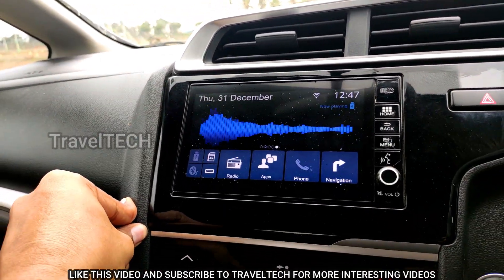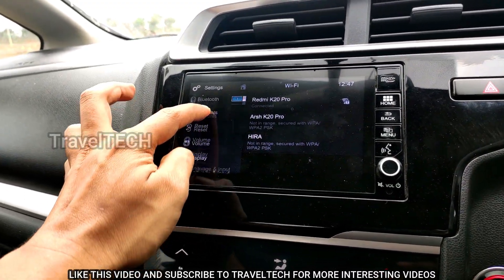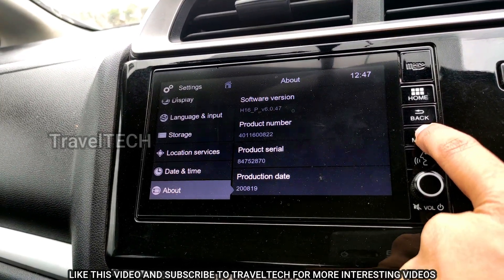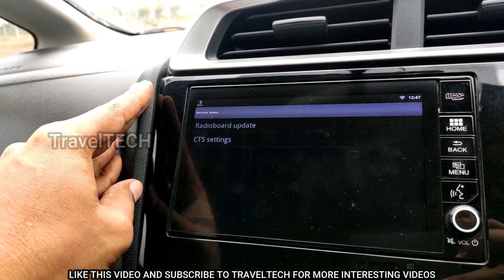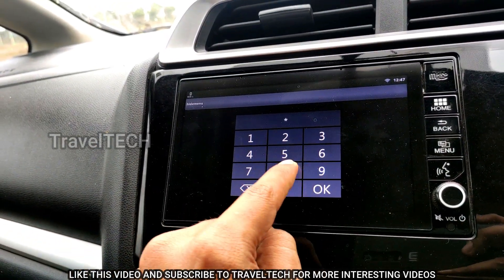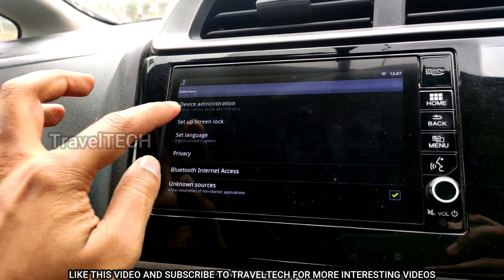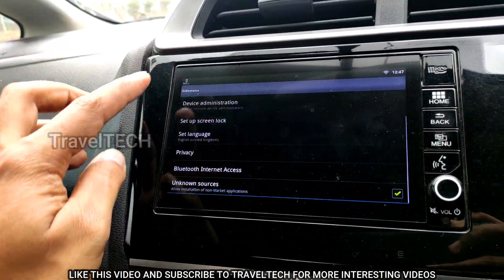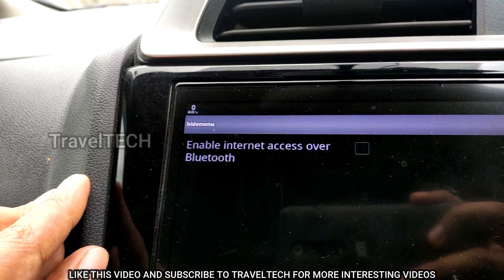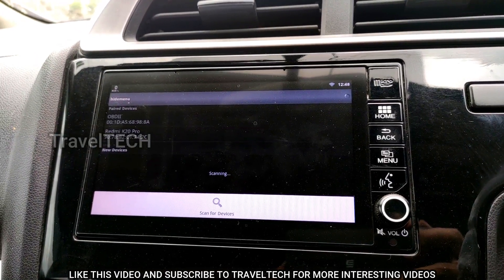If you do want to connect via Bluetooth, go to the Apps, then Settings of the Digipad. Scroll down and click on the 'About' section. Once there, click on the menu button — the heart button — about five times to open a secret menu section. Then click on 'CTS Settings' and it will ask for a password. The password is 9876. Once you enter it and click OK, the hidden menu of the Digipad opens. Scroll down and click on 'Bluetooth Internet Access', then tick 'Enable Internet Access over Bluetooth'.